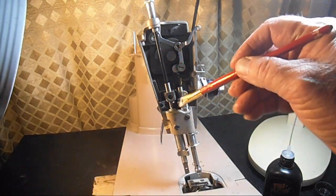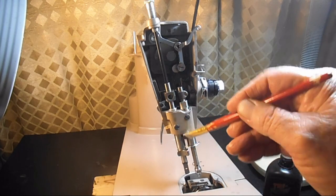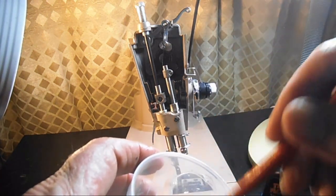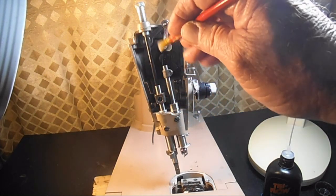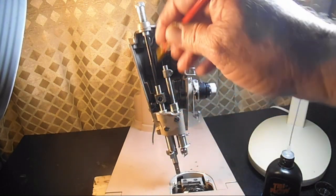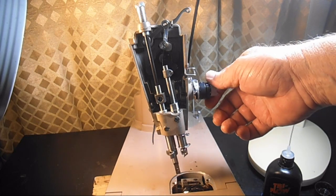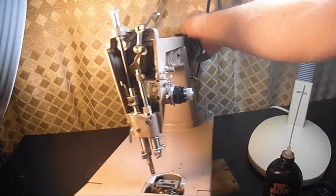If it's oily, the thread is going to slide right through it. I prefer you take it all off and clean it. I might do that later, but I'm trying to do the abbreviated cleaning and degreasing for you. I've got every bearing and bushing I can find, according to the manual, all lubed up with fresh coats of grease on the gears. It's too much — it's sloppy — but I can take off the excess. After all this, the excess is probably going to show up here. You don't want that on there — it's just going to make a mess.